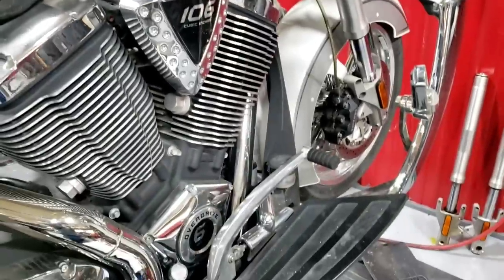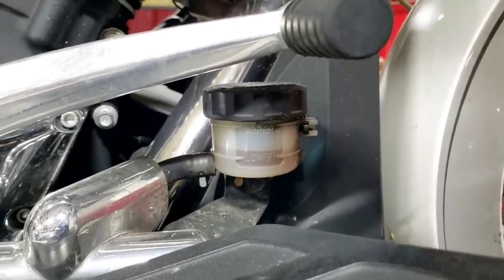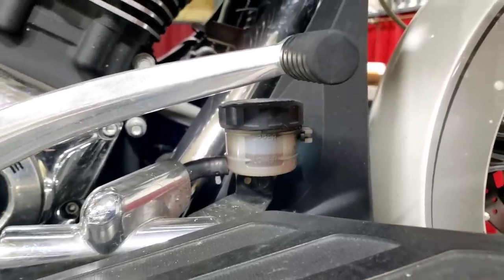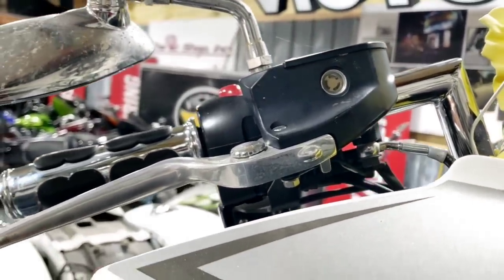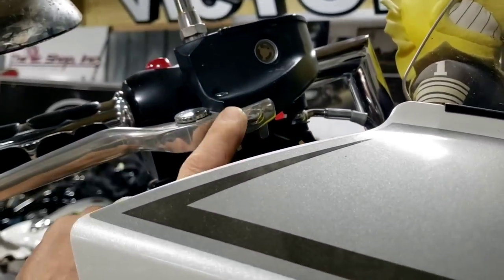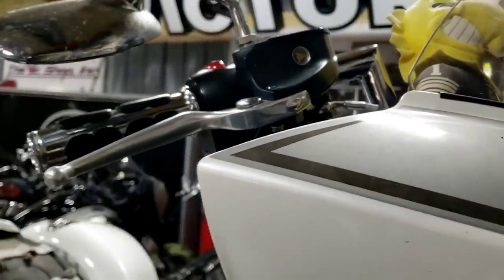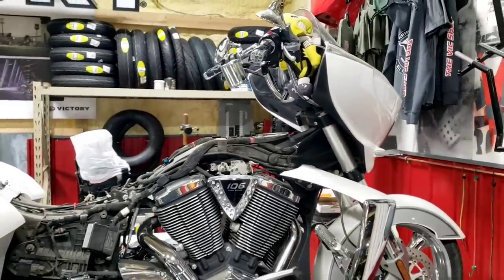Since we're here, it's a good time to check the brake fluid. The rear reservoir is easy to see and it's in the proper zone. If you want to be really diligent, replace the brake fluid and wipe out the reservoir every so often. Same with the front - pop the top off, replace the fluid. Also take the brake lever pivot out, clean and grease all of that.